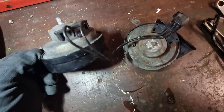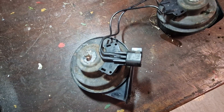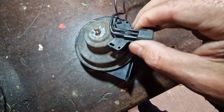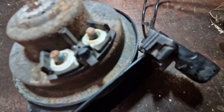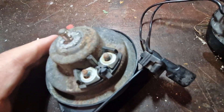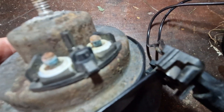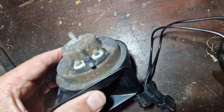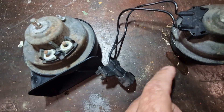I can't see any problems with any of the connections, so it could just be maybe an internal failure on one of them. I've just noticed that this actually clips on - I've released the clip and taken that off, and the terminals are in quite a bad way. They're quite rusty. You can probably make out there that they've gone a bit green and mucky, so I wonder if there's just a bad connection.